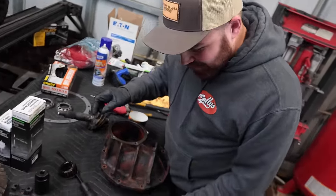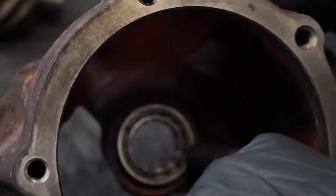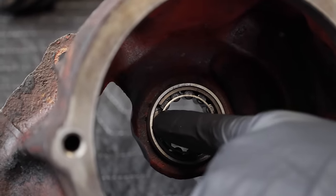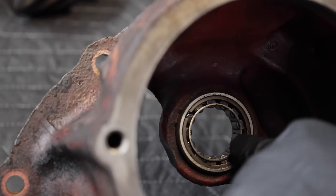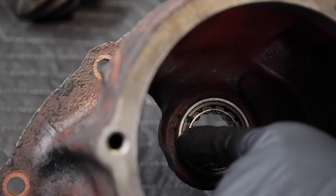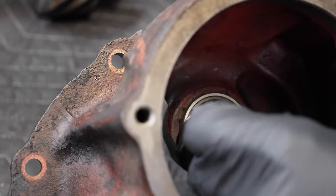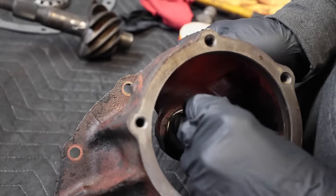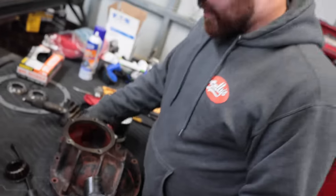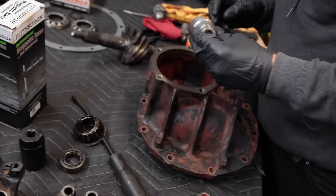Because you don't want... So basically, when you're hitting a bearing in, the outside of the housing is solid steel. That clip is what's holding all of those rollers in. If I bust that clip, we destroy the bearing. So I want to hit just the metal, and the socket we were using sits just inside of the outer housing when you center it up. And as a result, you could break that clip and then we wouldn't be able to build this tonight because of that one bearing.